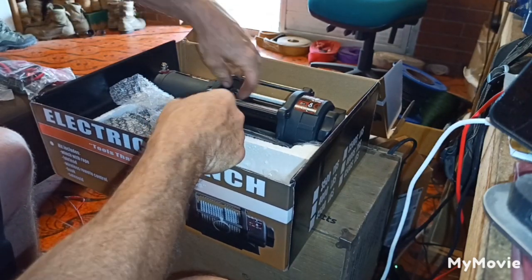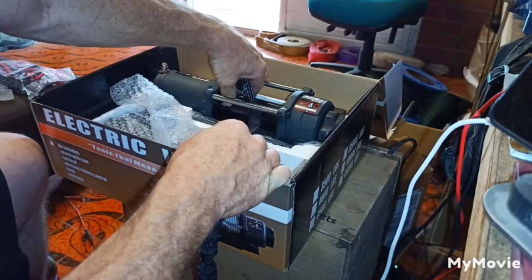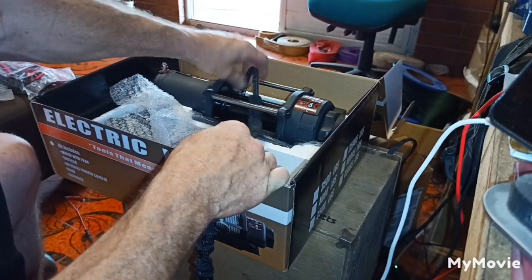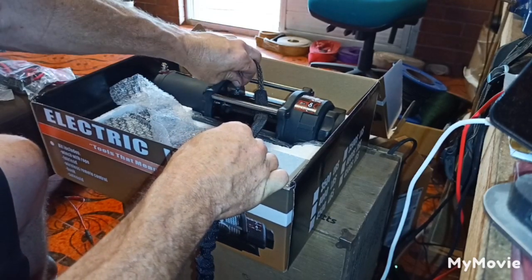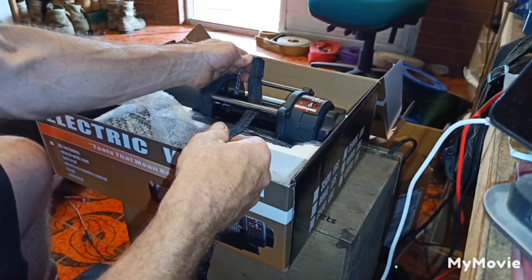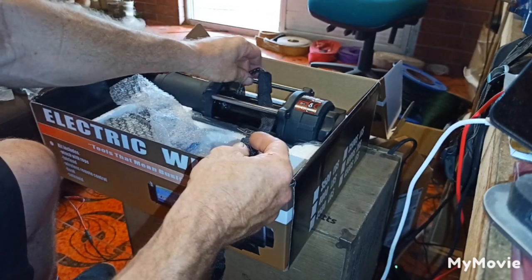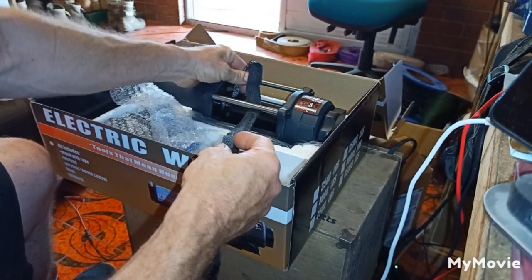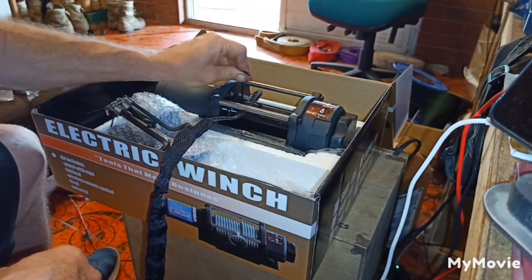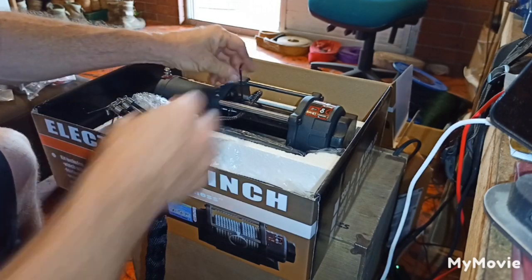As I suspected, it's just got the rope held in there with a grub screw. The grub screw is hanging out a little bit and that's causing a little sharp point - that'll cut your rope too. That'll just pull out of there if I'm pulling my rope out and I get to the end. I could potentially pull that clean out pretty easily. I'll show you a little trick to make that a bit more permanent so it doesn't pull out on us. I've got my little Allen key - set it into the drum screw and it wasn't even tight.